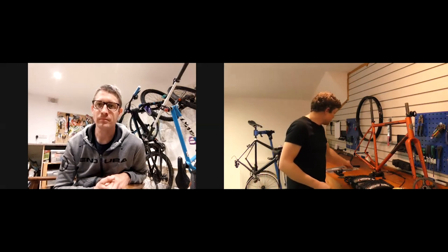Spokes have all been custom cut, courtesy of Custom Cut Spokes in Bournemouth. We're using the Sapim Race spokes — a straight gauge spoke, super strong. We're also using brass nipples. If anyone rides in really wet conditions, brass nipples are going to save you a lot of hassle down the line — they don't corrode as easily and you can always true up a wheel in the field. Tiny, tiny bit heavier, but you can live with that.